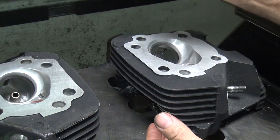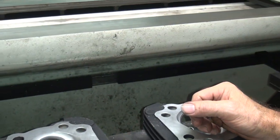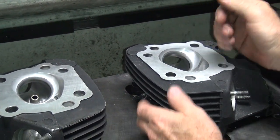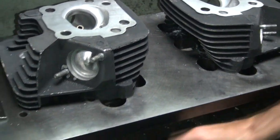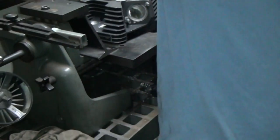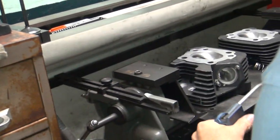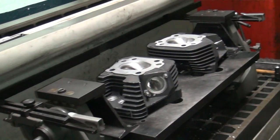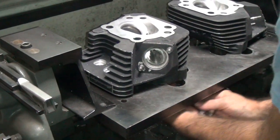There's a big lip right there — actually it's not a lip, it's just a straight edge, but it acts like a lip for the flow. So we're going to grind that top edge away — lower the compression some more, pick up some more flow. That little edge restricts the flow. The air is trying to expand and it's got a wall in its way that won't let it go. You've got to move the wall back a little bit so when the air is opening up, it wants to keep opening up. You're inside of a hot motor — the air is moving around a lot, it expands, it contracts. Everything matters — it's not just that stupid flow bench. Maybe that's why those numbers aren't real world all the time. All right, this is done for now — I'll have to do some grinding next, so we'll be back.